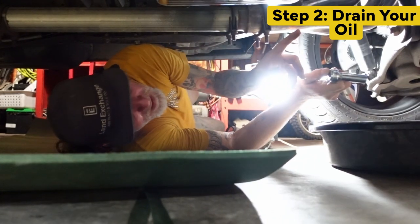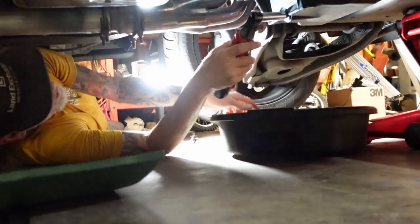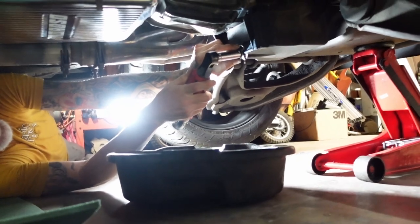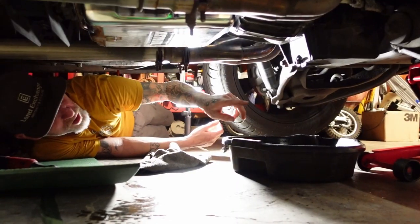With today's application on this LS 5.3, you've got an oil filter and you've got an oil drain bolt on the oil pan. The first thing you want to do is remove the 15-millimeter oil drain bolt on the pan. Once you drain it out, you've got to be careful — you need to let this truck cool off because this oil can be hot.